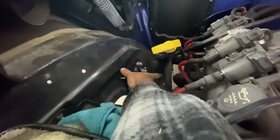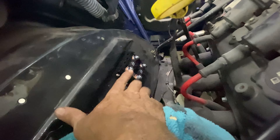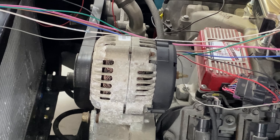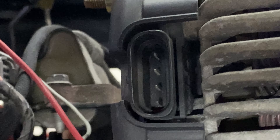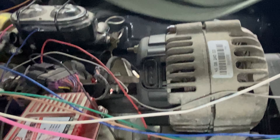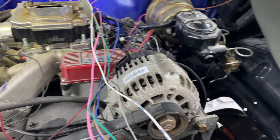That's temp-put in place - the wire will go from the battery to the mega fuse and power it up. Quick mention: this brown wire here is for your alternator. This is an LS series CS130D alternator and you'll see there are four identical pins in there. Some LS alternators have different-sized pins, but this one off a truck is a CS130D. You require a special plug for that - you can buy one from American Auto Wire, part number 500-295.